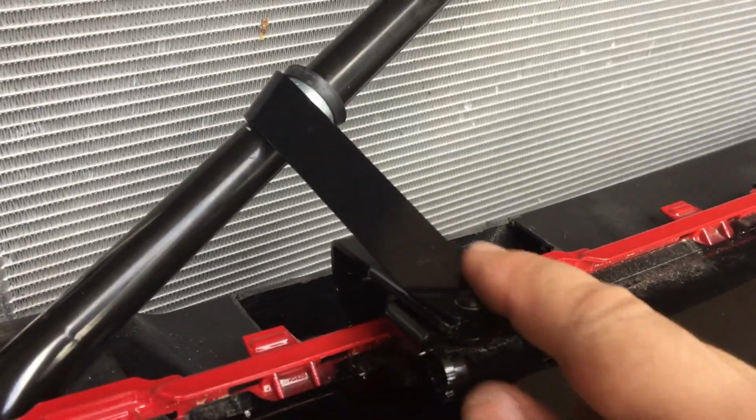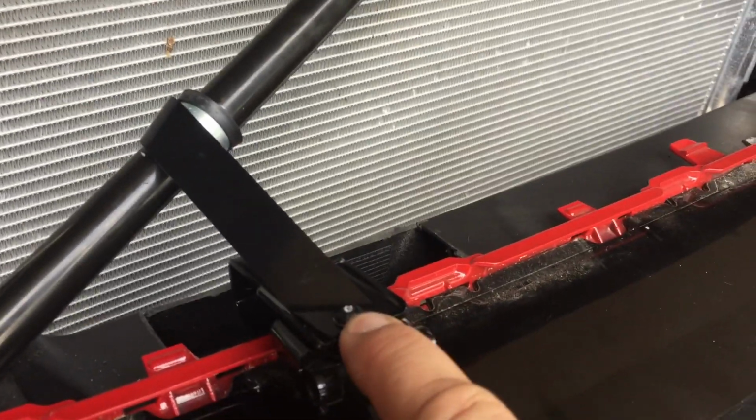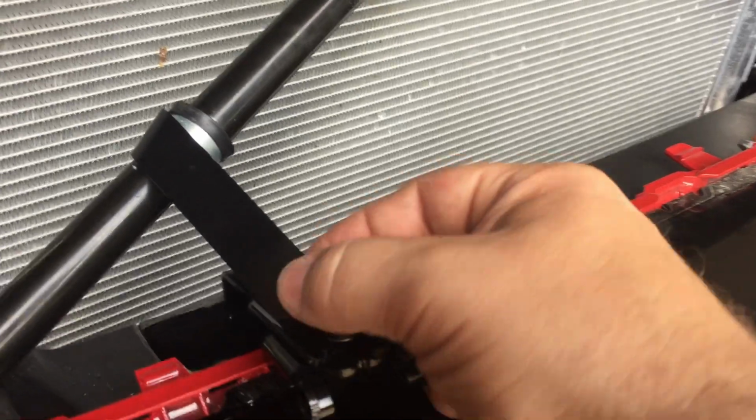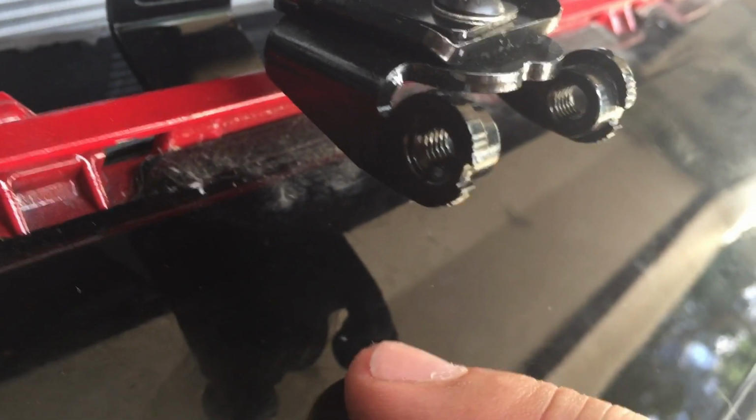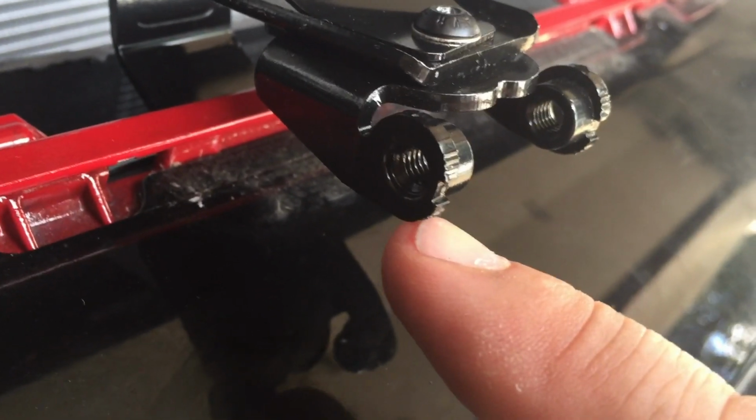A couple things with the end of this was when you put this strap on, do not tighten this screw up. It says to put it in three threads, which it'll be loose, and then go up here and mount the top of your strap here. This strap has kind of a natural bend to it, so kind of wrap it around, line your pipe clamp up with your 190 millimeter mark, bolt this nice and snug, and then you come back over here and they tell you to take a measurement from here down to the bumper. Okay, and I measured 13 millimeters.